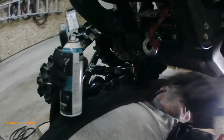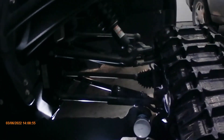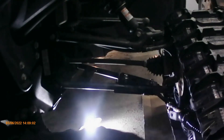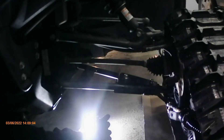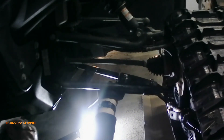After a one-mile slow ride, lock that up — not too tight, 30 foot-pounds is the spec on that. Go for a one-mile ride and bring it back and recheck all your measurements. I'm going to put a little bit of spray on this ball socket here to lubricate it, and that's good for now.